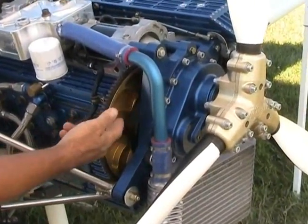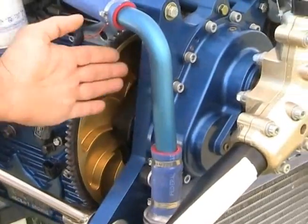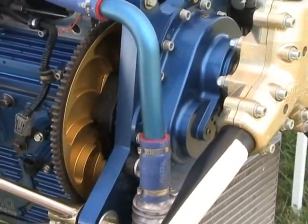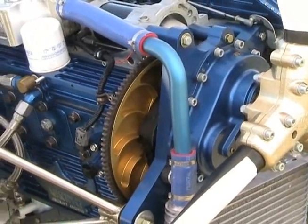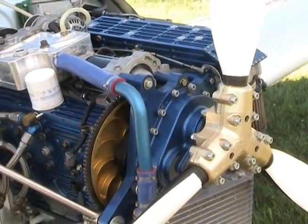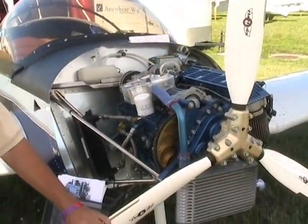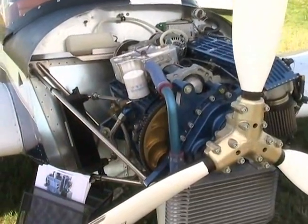The flywheel has been machined as an impeller — it sucks air in from the surrounding area and cools down the damper assembly, as well as the gearbox itself, which is hollow on the backside with fairly thin wall thickness. For people who know about gearboxes, the bearings and shafts are only as good as the alignment of components at operating temperature. With this fan built into the flywheel, the in-flight temperature of the gearbox is less than 130 degrees — just slightly above what you can feel with your hand. The gearbox is producing heat but being cooled equally well from the back.